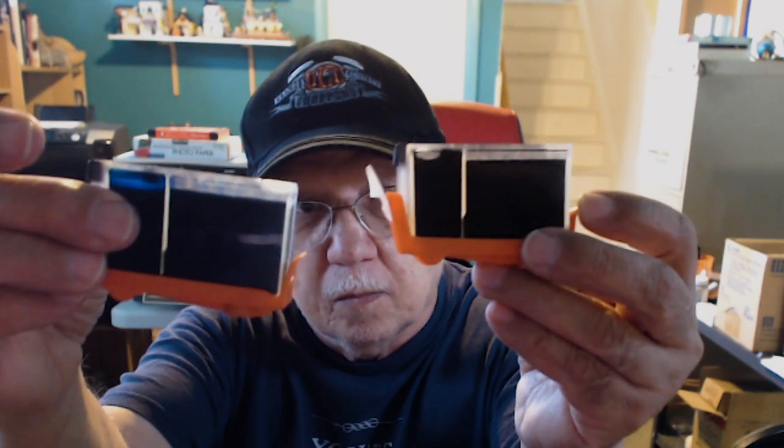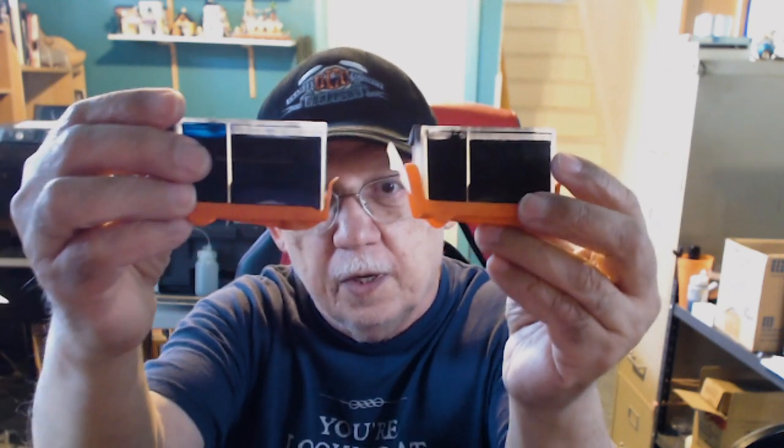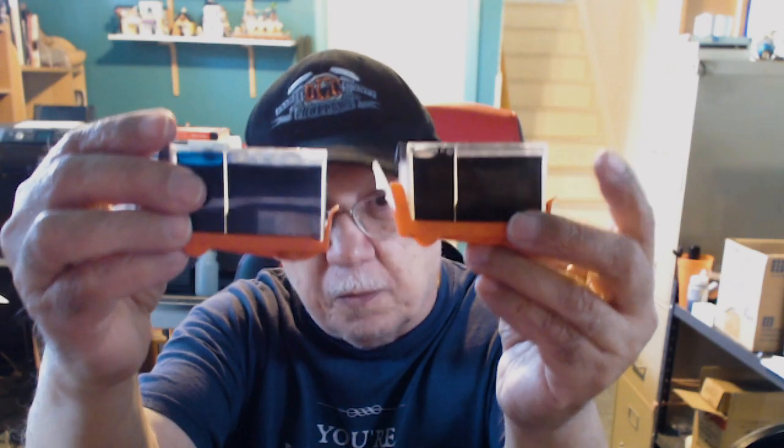So you will have to experiment a little bit as to how much ink it requires to refill to the correct level. If you have one of your own cartridges that you allow to reach empty, it may only take about 10 milliliters of ink to bring it up to full condition. And that looks like this. Okay, as you can see, a black one and a cyan one over here. And they are filled to the max minus about 20% on the liquid side. And these, of course, are non-modified cartridges. And they were just refilled in the video that I will then show you next.